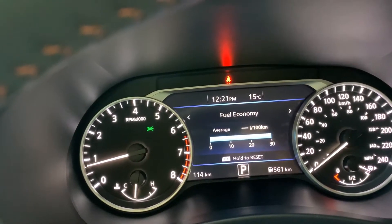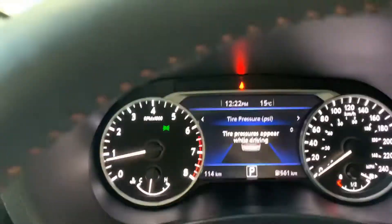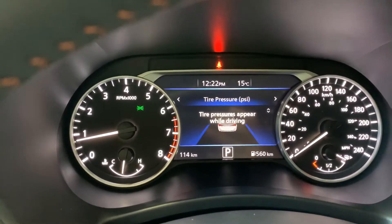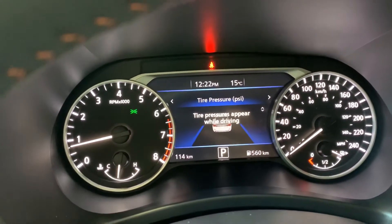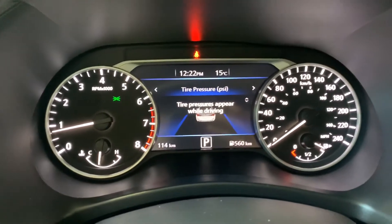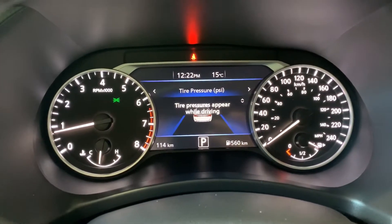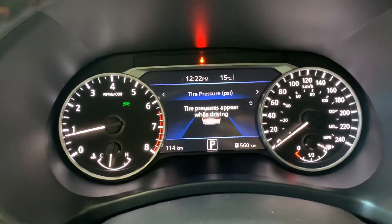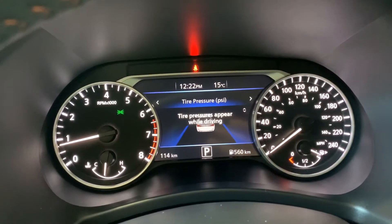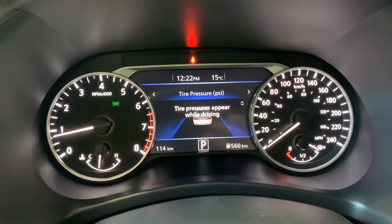The next screen to the right is for your tire pressure monitoring system. Once we start driving, all four wheels will appear and show the exact pressure of each wheel individually. Whether you're on this screen or not, if you get a low tire pressure it will pop up with a warning telling you which tire is low and the exact pressure. Go put some air in your tire — when you reach the right pressure, the horn will beep to tell you to stop. If you continue past the upper limit, the horn beeps three times. Make sure you do this to all four tires so you have the same pressure and get even tread wear.